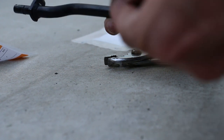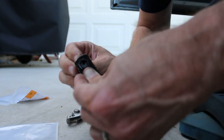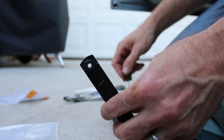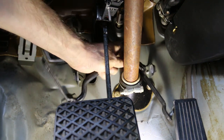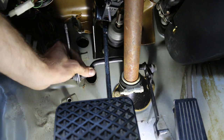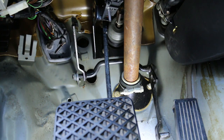This is a little worn down but I think it's going to be fine - shouldn't have any issues. It's got a little bit of gunk on it so I'm just going to clean that up. This is the actual part that actually broke on me - this right here is for your accelerator pedal throttle cable. Pressing it in has a really, really tight fit. Now we got that grommet in there. I think we're looking good with those new bushings. Kind of slide it in as we did before - and oh yeah, see there's no play anymore which is nice. Before I had all that jiggle - now I'm not going to have any more jiggle there.